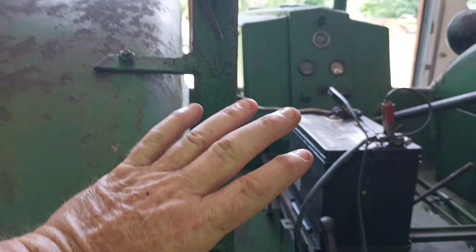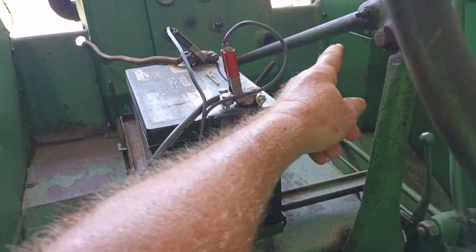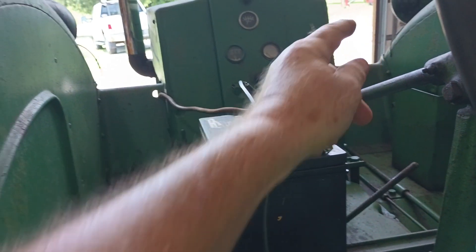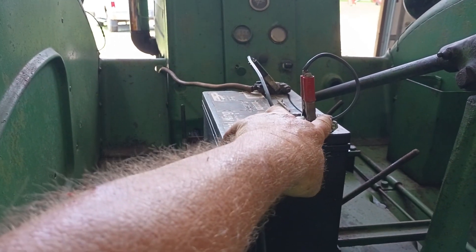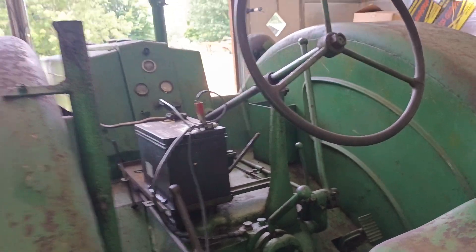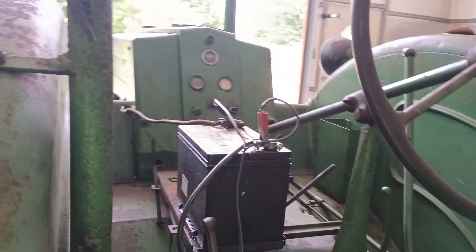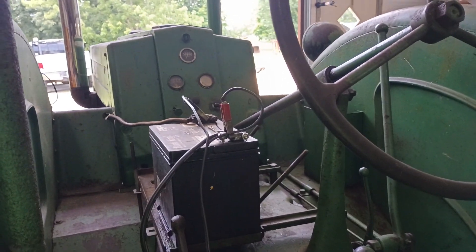That's how you charge them. Now if you've got 24 volts — which means this positive lead would go to the negative lead on the next battery, and that negative lead would go to the positive lead on that battery — I always use my first set of batteries and go positive to positive, negative to negative, and it'll charge the other battery. A lot slower, because now you're charging 24 volts unless you've got a 24-volt charger, but it'll still charge that way and you won't affect anything. It's no different from charging a single 12-volt battery — it's just taking more amps to charge everything up.